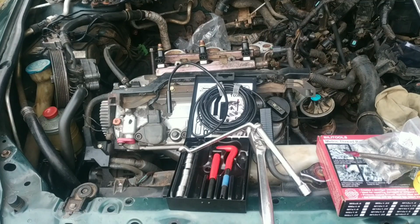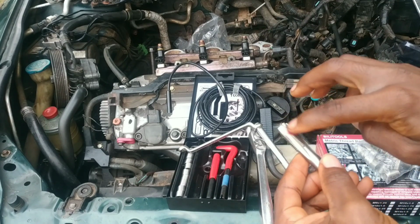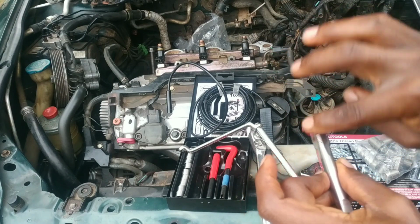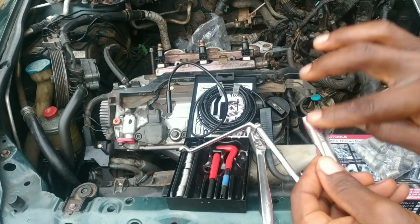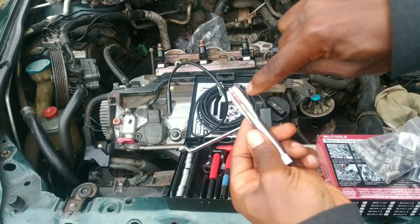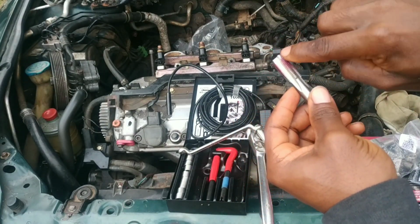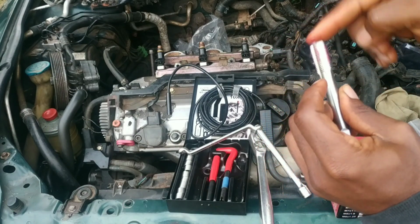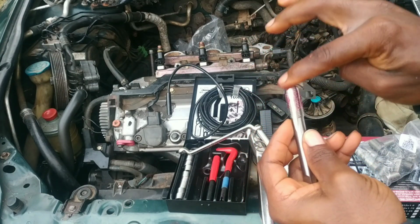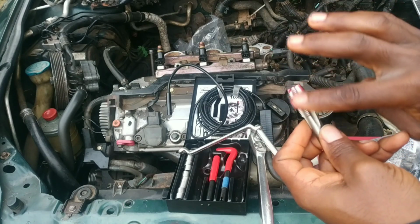So next, before going ahead to make the new threads, I'm going to lightly apply some lubrication to the tool, like I'm showing right here, so that everything gets done properly. Yeah, just a little, especially to the threads. The tool is particularly cool in its design because the grooves right here would hold the fragments that it will cut to make the threads. So I'm also going to apply some to the tip right here, like I'm showing, and then start making new threads for the helicoil nut head bolt. So I think that's good.